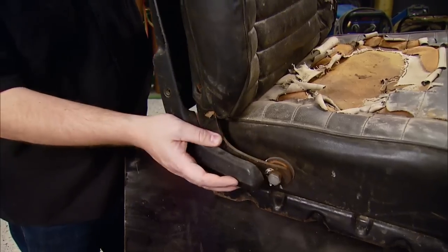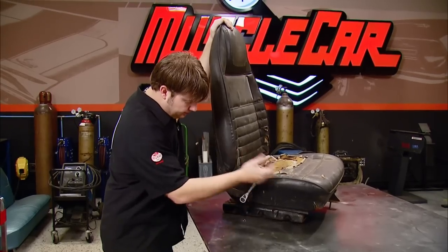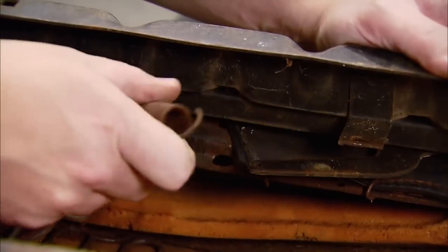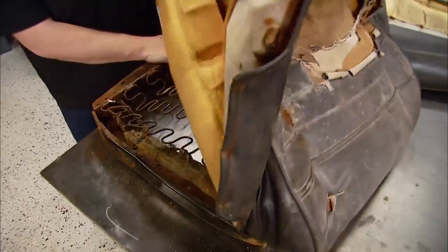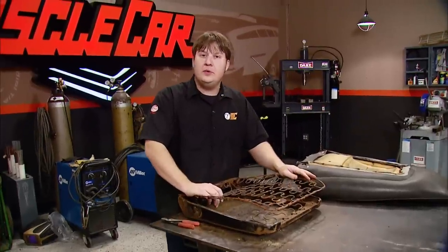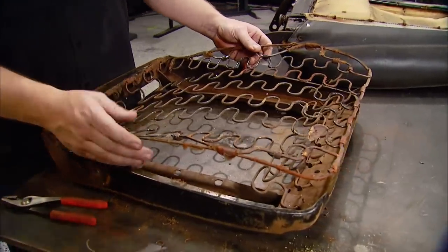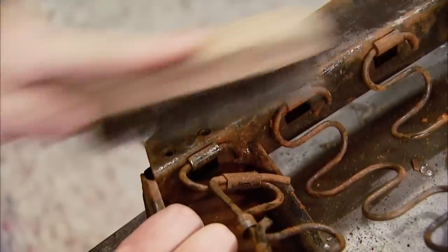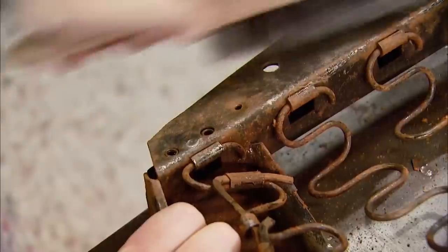It just takes a couple of screws and bolts to get your seat back and bottom separated — just make sure you don't lose any hardware while you're at it. Now with our seat frame all stripped down, we're going to knock off this old rusty scale and put on a coat of protectant. It'll stop any further corrosion and improve the looks of this old nasty thing. A simple way to do this at home is with a wire brush — give the rough spots a good once-over, making sure to knock off the scale that's developed on the surface of the metal.